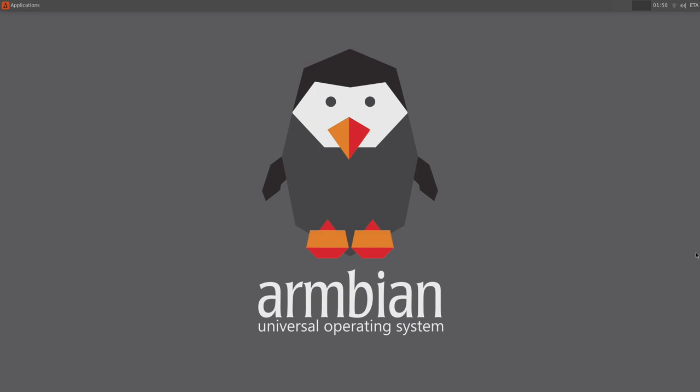The first thing I like to do is a full update with any operating system. You will need to be connected online with this. Since I have an XU4, it doesn't have built-in Wi-Fi. I'm just using a cheap USB adapter, or you can use Ethernet. If your board has Wi-Fi, more than likely Armbian will support it. If you're familiar with Linux, you can just go up to Applications, open the terminal, and do an apt-get update and an apt-get upgrade. If you're not that familiar with Linux, Armbian has made this very user-friendly.